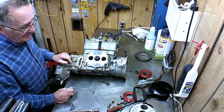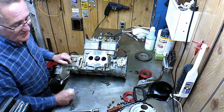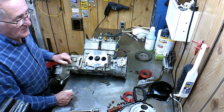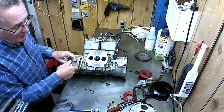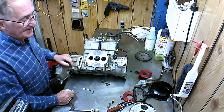But anyways, the most oil we could get it to pump in there was going to give you 70 to 1. That's the richest oil flow, 70 to 1, and that's with us blocking the stroke full on all the time. It was just blocked open.